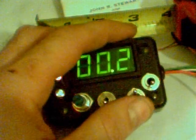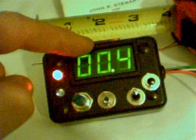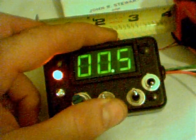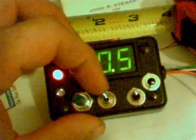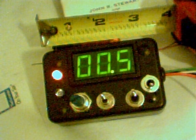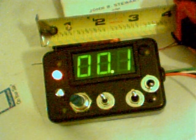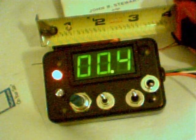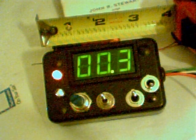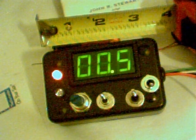Switching back up connects the simulator back to the meter. To recap: the middle switch hooks the meter to either the simulator or the O2 sensors, while the first switch hooks either the simulator or the O2 sensors to the ECM itself — a nice versatile setup. We did experiment with a couple of different cars, OBD1 and OBD2. Interestingly, OBD2 responded much better than OBD1. With OBD2 we had full control throughout the entire rich-to-lean range; OBD1 wasn't quite as responsive, tending toward rich or lean without as much mid-range control.